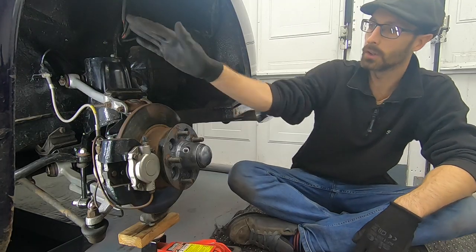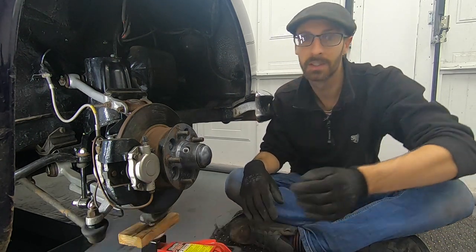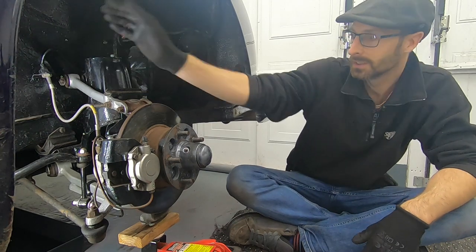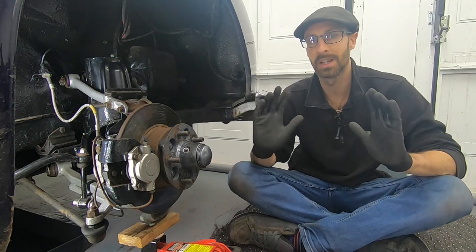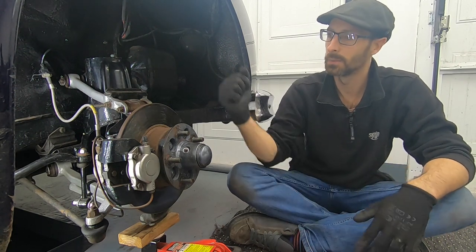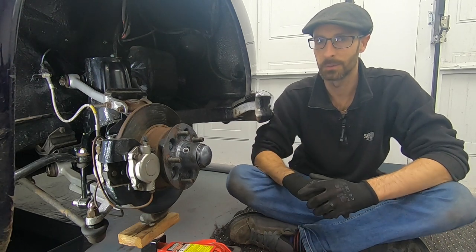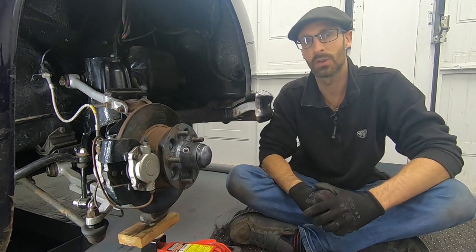As I said, you've got ball joints top and bottom, you've got track rod end — those are the normal culprits. There's also bushings all the way on the two wishbones, but all of those have been replaced so I know they're good. The way to check is normally to get a pry bar in there and just start moving things about. But in this instance what I'm going to do is jack the wheel up, and that should reveal our culprit.